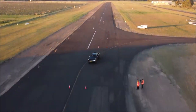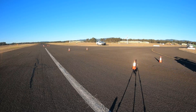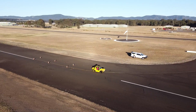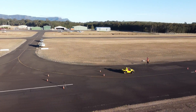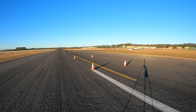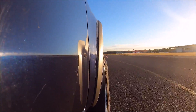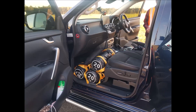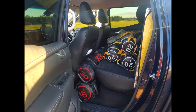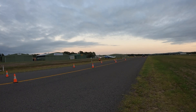Any other weighted items should be removed to give the vehicle the best chance of passing the test. It is also recommended to remove anything attached to the roof, like rooftop tents, jacks, and racks, as this raises the centre of gravity and can affect the test. Make sure the tyre pressures are correct for your vehicle, and the brakes are adjusted if they are of an adjustable type, including the handbrake. Although the braking system isn't tested in LT2, it is a safety requirement. The cost of a swerve test normally ranges between $2,000 and $2,500 depending on the vehicle — most of this covers insurance, wages, equipment, and track hire.